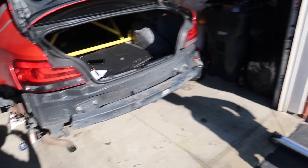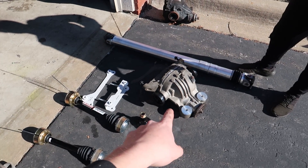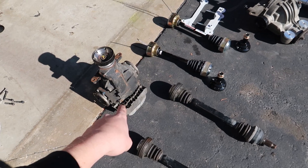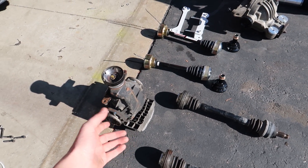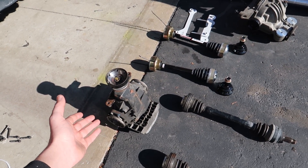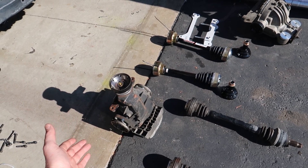Let's get this done — we're sending burnouts, it's so close! The big difference between these differentials: that's the Ford 8.8, and that's way stronger. This is the BMW 210. So this is an M-variable differential with LSD. M-variable relies upon oil pressure — there's a pump inside of it to put pressure to both wheels. It's not consistent.